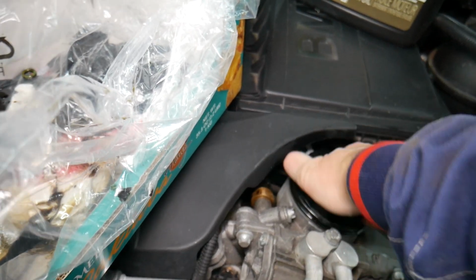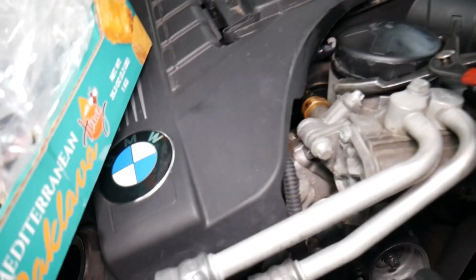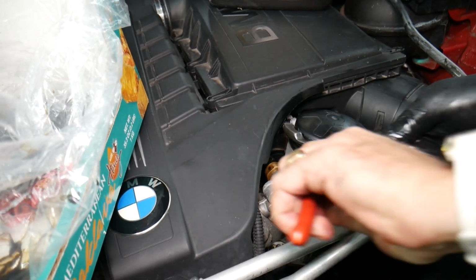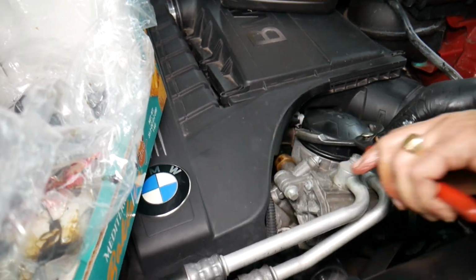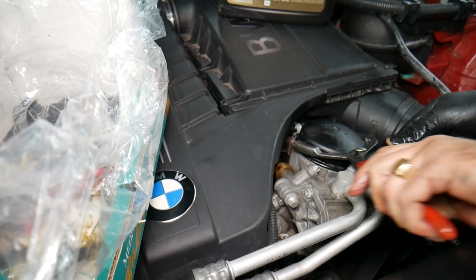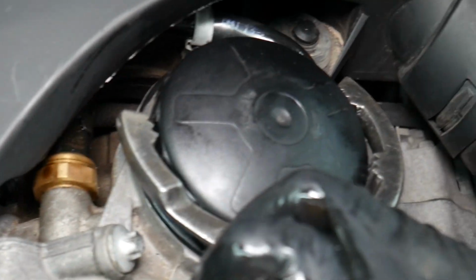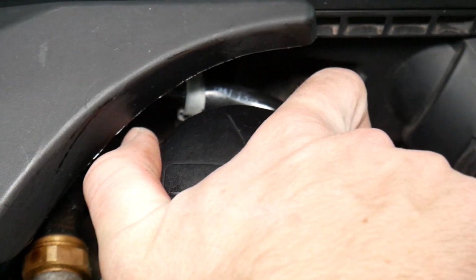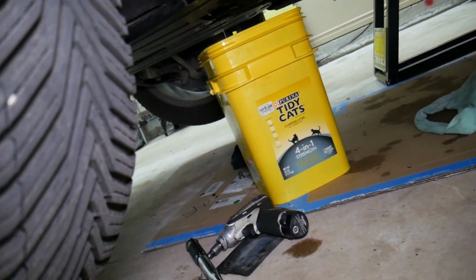At first it goes by hand, and then we need to go ahead and get the pliers, because that new seal will be harder to compress. So we're going to stop once it reaches the bottom. Okay, it's probably 4 more revolutions, it's actually less than 1 revolution, because we don't go a whole revolution. Okay, watch now, it's approaching the housing now, it will stop. If you use the wrench, it's really cool because you can use the Newton meters, set a torque wrench and get it at 25 plus 5 Newton meters. So this one's ready, guys. Now, so far, things not to forget: tighten the oil filter and install the oil filter. Make sure it's the correct filter too. That's a new drain plug here that we're going to replace, because our old one is still there underneath.